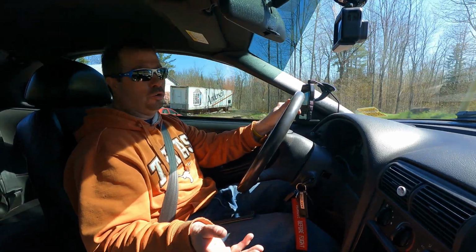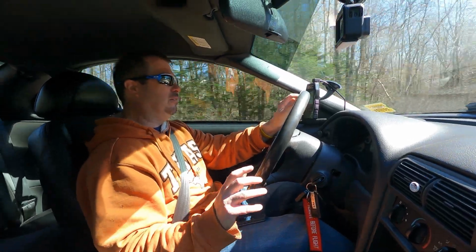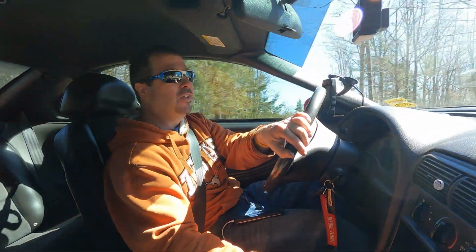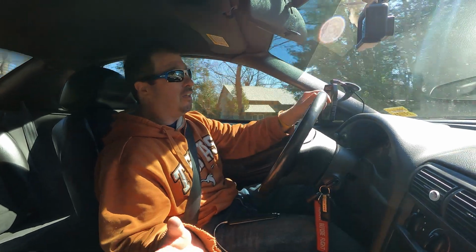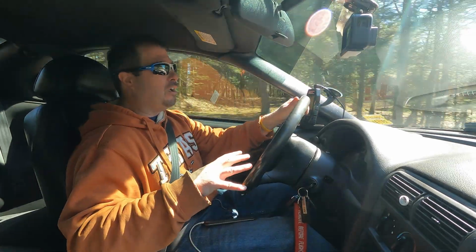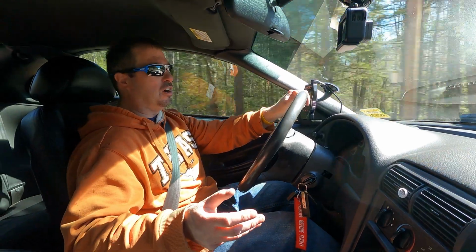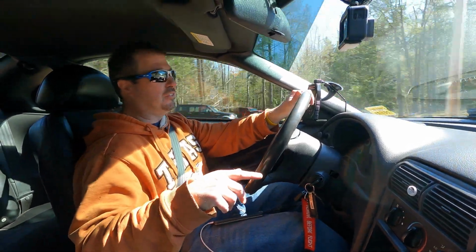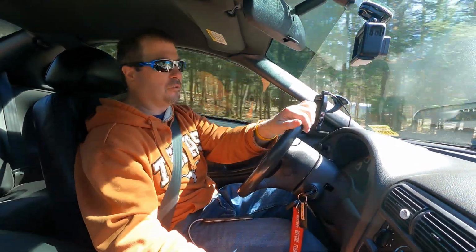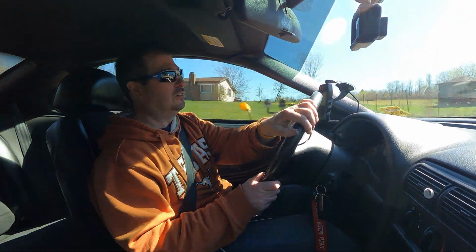It might actually be ordered by the time you guys are watching this, because I'm actually filming this on May 1st, and by the time you watch this, depending on when I put it out, maybe I already ordered something, maybe I didn't, but you'll have to keep watching and find out. But my point is that I don't want to go and buy a belt to fit this setup right now, and then within a month and a half to 2 months buy another belt, because the pulley size for the supercharger is going to be a lot bigger than the 276 that I have on there. Because if I run a 2-something size pulley on an aftermarket blower on this, I'm going to be over 20 pounds of boost, and I don't want that on 93 octane.